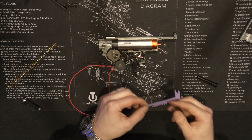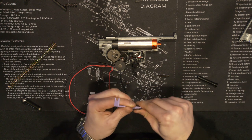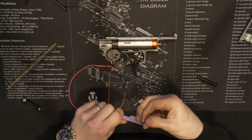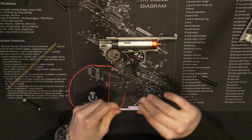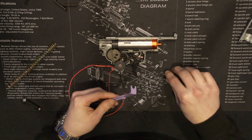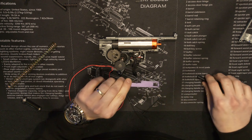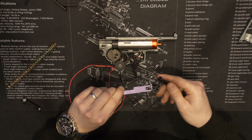We now need to place the tappet plate. So we're just going to grease it slightly, not too much. You can use a brush or wear gloves when you're doing teching to not get grease all over yourself, but you lose a bit of feeling that way, so it's often easier just to wash your hands afterwards.